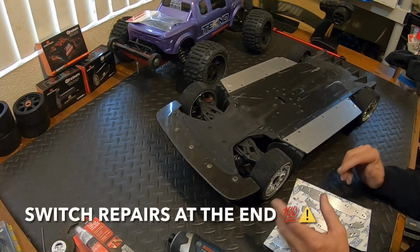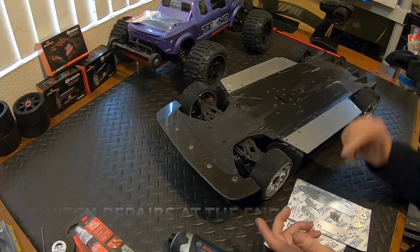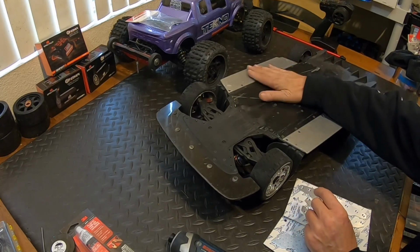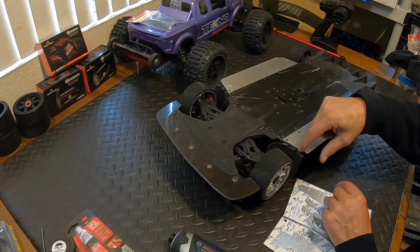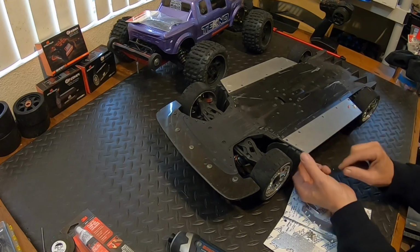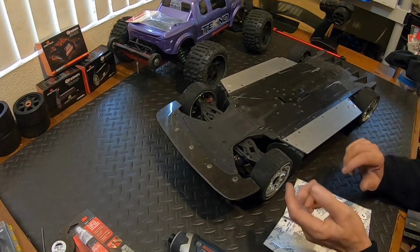I'm sure I have a small 100 amp ESC that I don't use. I can take it apart and steal the parts out of it. I never was able to find them. But the aluminum things did work. I'm probably going to drill another hole to secure them right where the tab is, and I might stack up some washers underneath it to give it that curve to get them away from the tires.